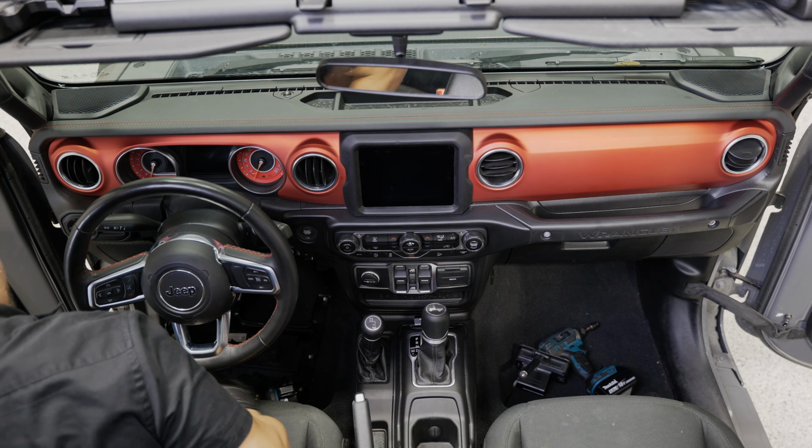That is a 5/32 Allen. To pull those out, we'll put our brackets on there. Then you'll have to remove this panel here, which is a T25, I believe. Where this carpet snap is, you have to remove the nut that's holding that on, and that's a 17 millimeter socket to pull that off. So let's prep our sub up, pull these Allens out there.